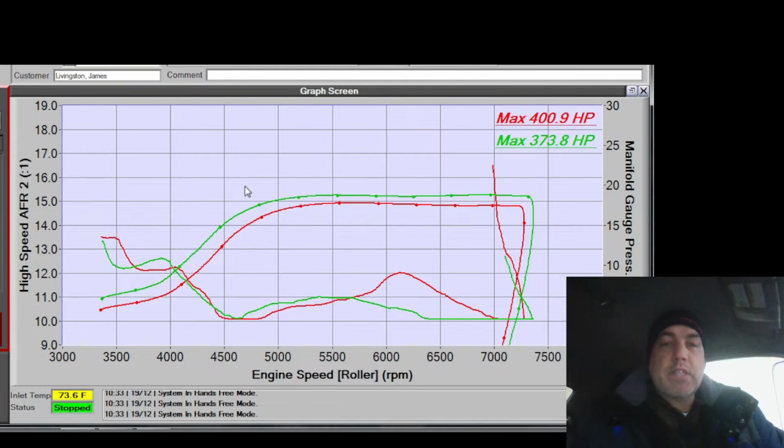And look at this. So 4,600. I'm looking at that really rich dip. Okay, so 4,600. My fuel pressure differential is about correct, within a pound. My calculated load is 355. My timing is 12 degrees. My duty cycle is already 45%. So maybe, my VE command is 104. So maybe I just got too much fucking VE on it right there. That must be what it is.